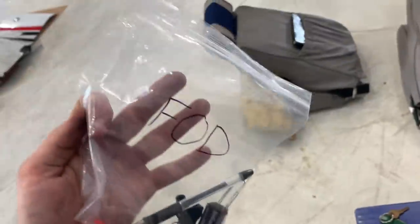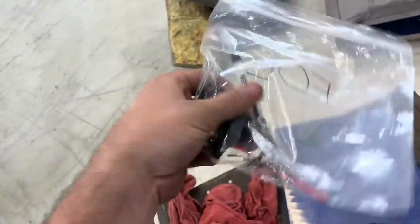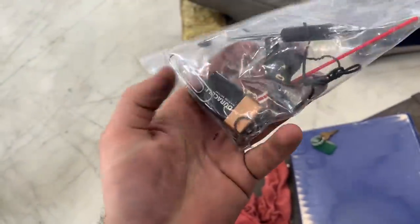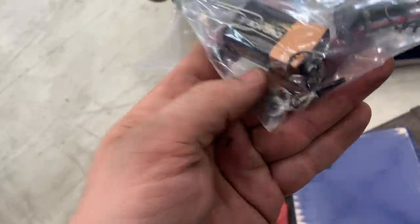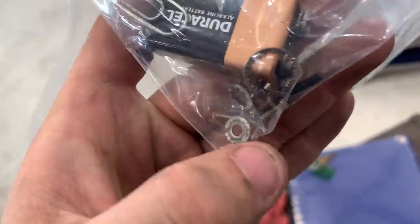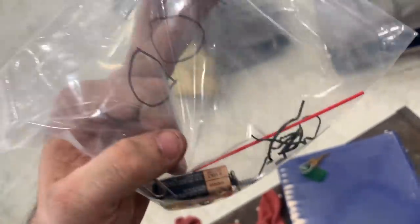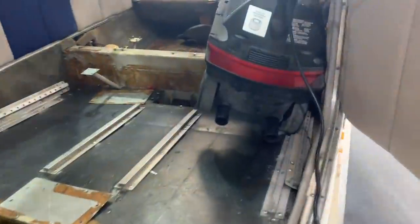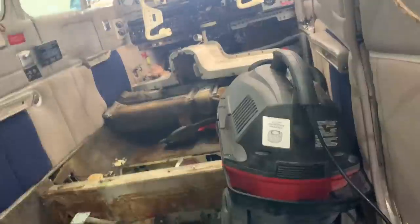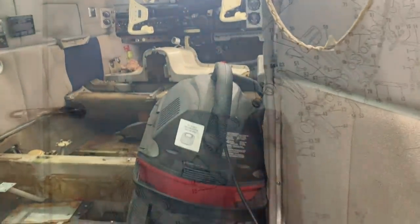This is my collection of FODs so far — these are things I found under the floor panels, not just under the seats. Legitimately under the floor panels. A lot of avionics stuff up under the dash. Now I've got my alcohol, my rags, and my vacuum cleaner — I'm going to be cleaning that filthy front so the IA can run through it and actually see cracks and stuff. Right now you can't see nothing.